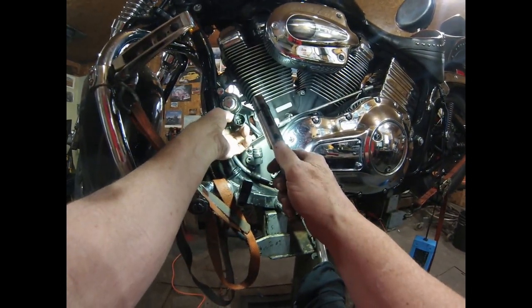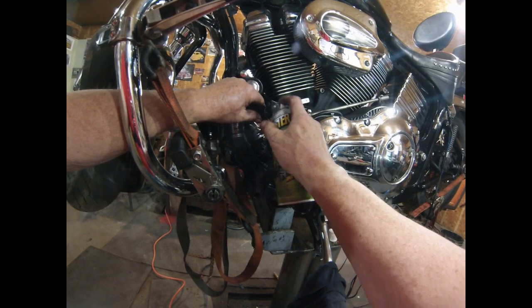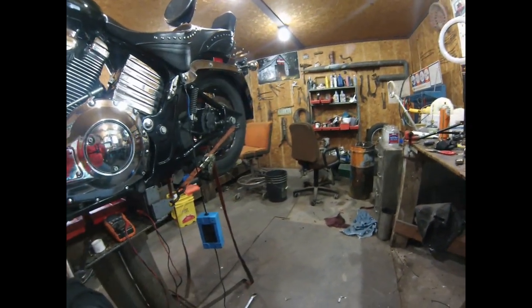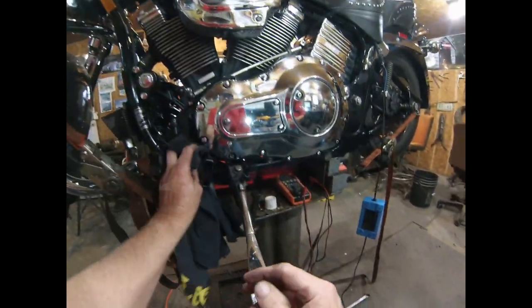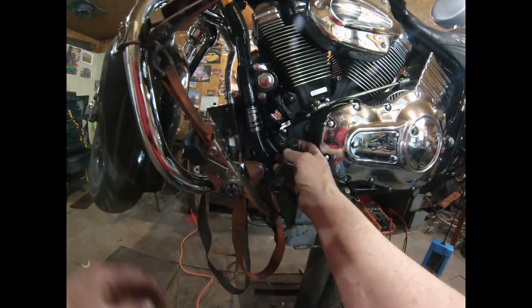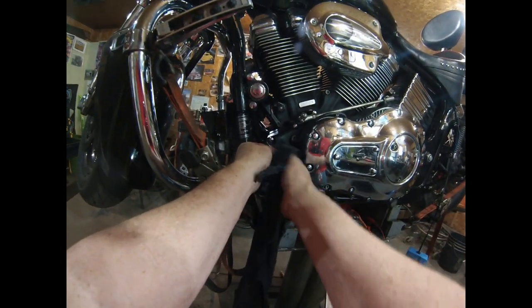Anyway, our stators charge all the time. It shunts voltage back through the frame. And some people in the community believe that's why our bikes run so hot, because the stator gets hot. I'm no electrical engineer. I couldn't tell you if that's true or not. Looking at this, I'm thinking I may want to switch over to that new type of voltage regulator so this doesn't get so hot.